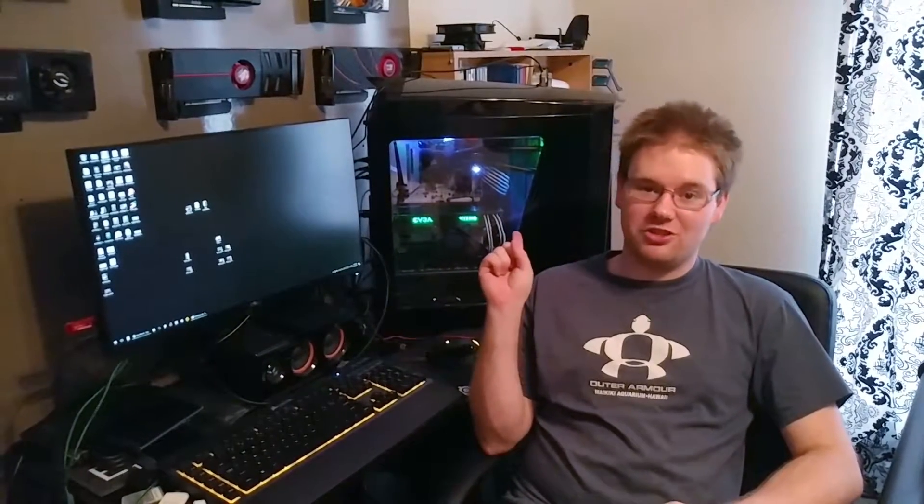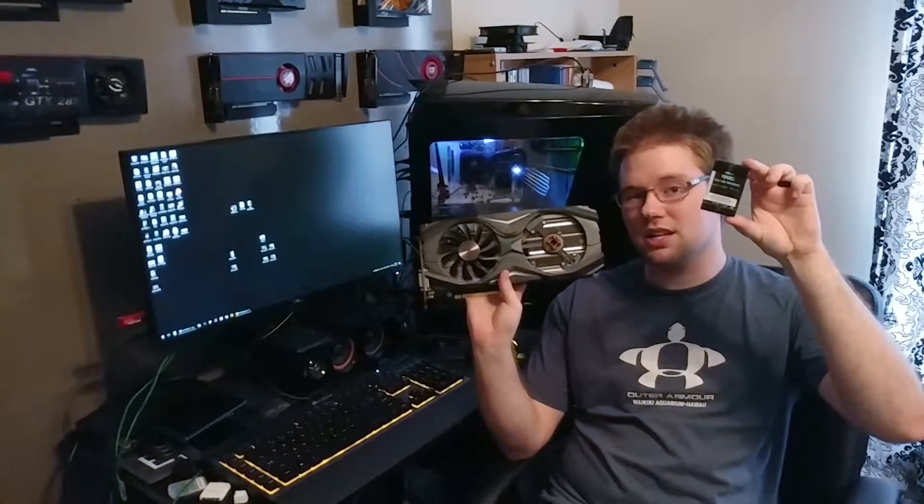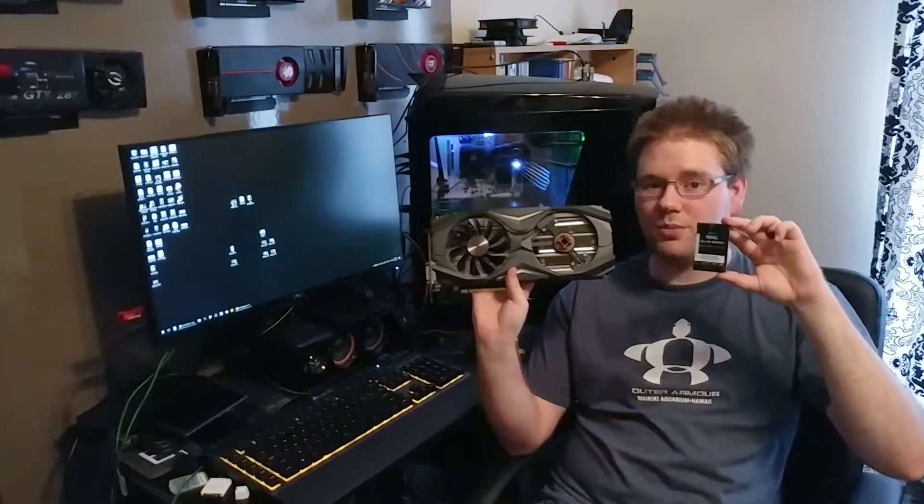The only thing better than having one GTX 1080 in your gaming computer is having two GTX 1080s in your computer. Or having a 1080 Ti — that probably would have been a better use of my money. For running two GTX 1080s in SLI, if you're playing at 4K, which you would have to be at least, if you're using two of these cards, Nvidia says you need their HB SLI bridge, which if you buy it new tends to run about 40 bucks if you don't have a new motherboard that came with it in the box.